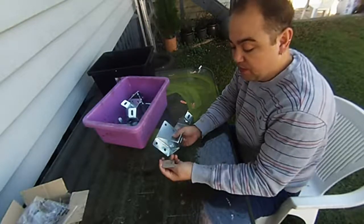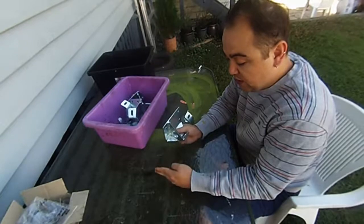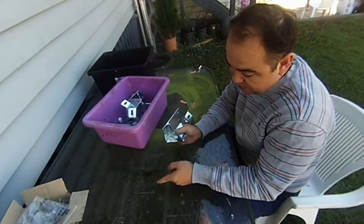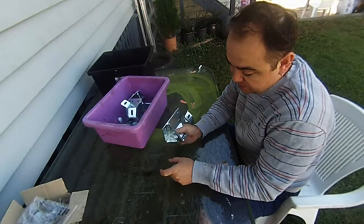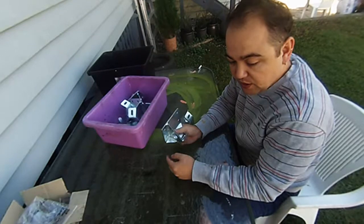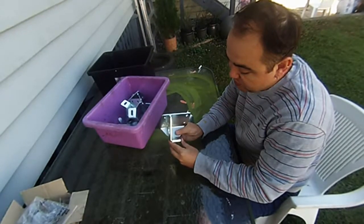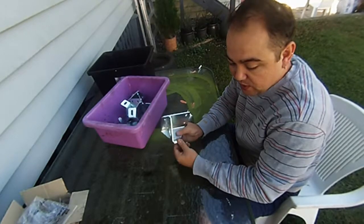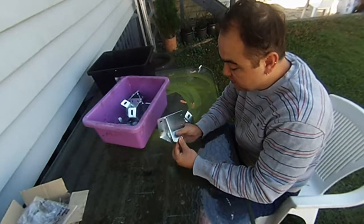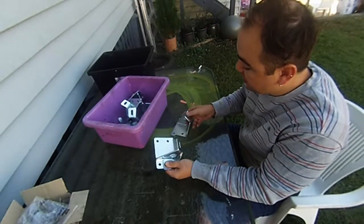This is the shim, just in case you run the rack relocation. When you move the rack forward, there's a big rib in the block, and where the clamps are, because the rack moves forward, it gets really close to it. So I just try to pack it up a little bit more, get some more clearance between that rib and the clamp, just so it doesn't clash under torque. But it's a long weekend, so hopefully I'll fit them this weekend.